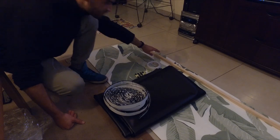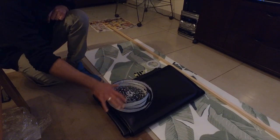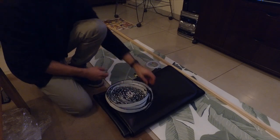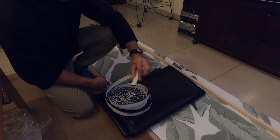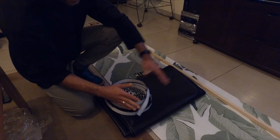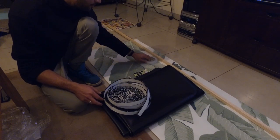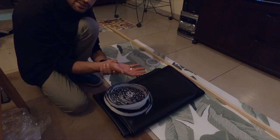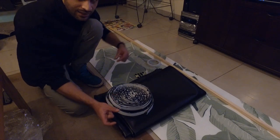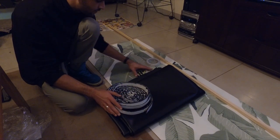We have our dimensions and a straight edge to keep lines accurate. I'm going to take the dimension of the bed and add 25 millimeters on either side — the velcro is 25 millimeters wide and the steel surrounding the bed is also 25 millimeters. We'll add that allowance, fold the corners in, stick everything together with double-sided tape, and the velcro will go on the inside as a single seam. We'll put that on a time-lapse and start measuring, cutting, and go from there.